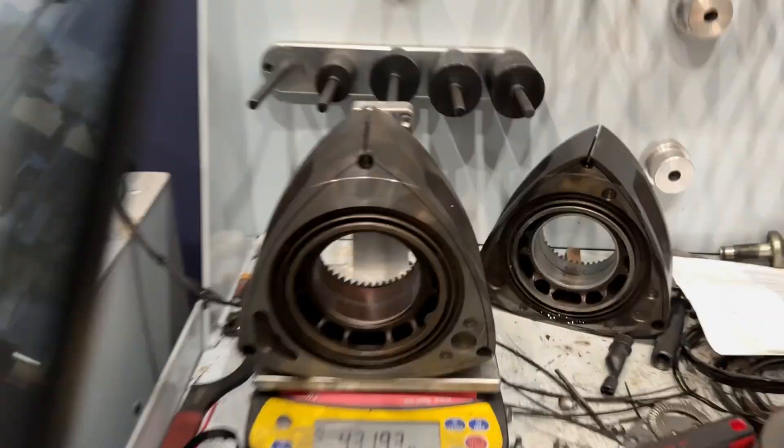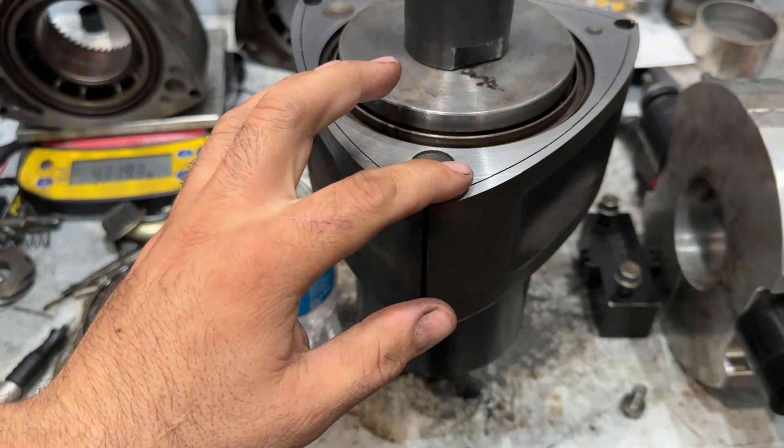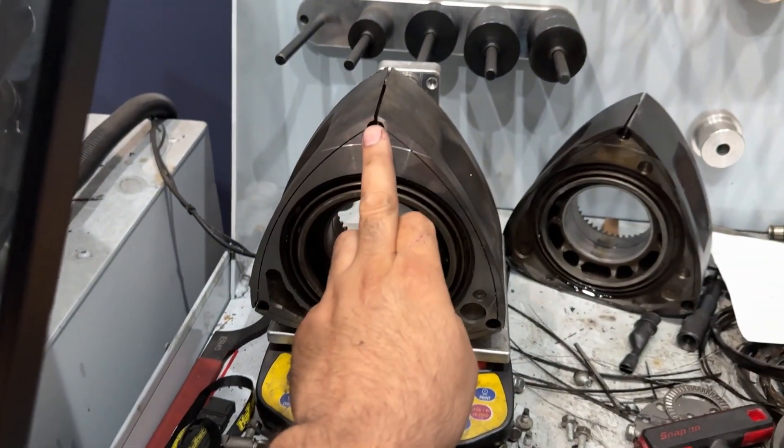It ended up not looking like it. That's not what a 5,000-mile bearing should look like. We've been clearancing the rotors and gave it clearancing for high RPM, high power. This engine right here is going into a yellow FD — if you're an OG, you know that this car is Ernie Taylor's RX7.